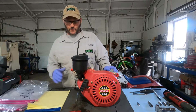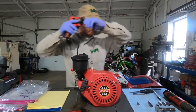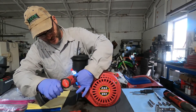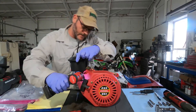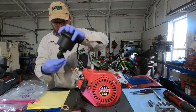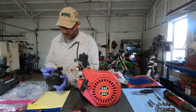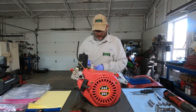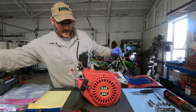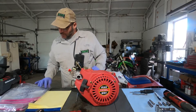We're going to go ahead and remove the entire air filter assembly — all that is is two 8 millimeter screws, and when I say 8 millimeter I'm talking about the socket size; they're actually a 6 millimeter thread. There is a paper gasket — it fell off the first time I took it off but it's in good shape. Now this engine does have some writing on it in English: it says 'diesel' and over here on the side it says 'stop' — that's pretty much it.